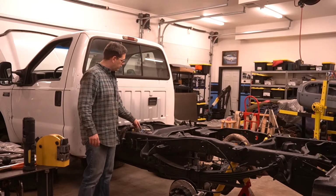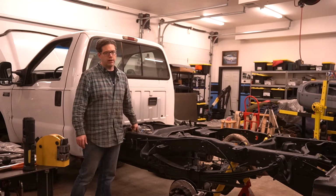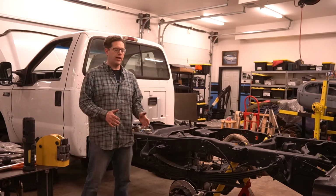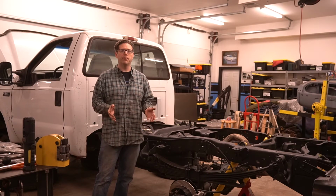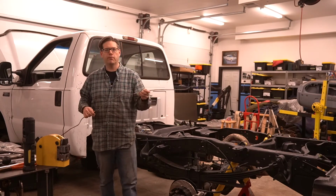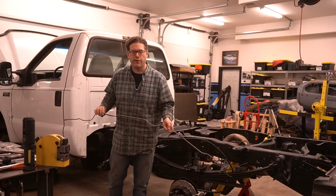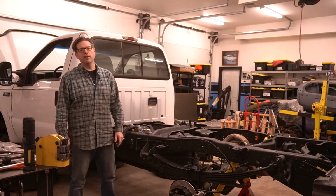Well, you have your fuel send and return line, you have your vent line that goes to your charcoal canister, and then you have your brake line in there as well. Well, the brake line is all the way at the bottom of that mess, plus you have the electrical harness that runs there too. What we're facing is the challenge that actually pulling out the brake line was quite difficult, and probably one of the reasons that the weak spots broke as I was pulling it out is that there's just literally no room for the bends. The bends in that line, it's very difficult to pull this out from the frame with the fuel tank in place. So the thought of trying to get this back in without mangling it and actually mimicking the factory bends, or heaven forbid I buy a factory line and try to put it in, I really just don't see how I'm going to be able to fit that in here with this tank in place.